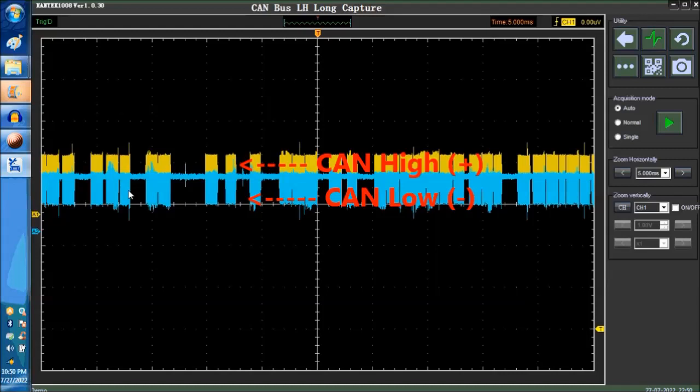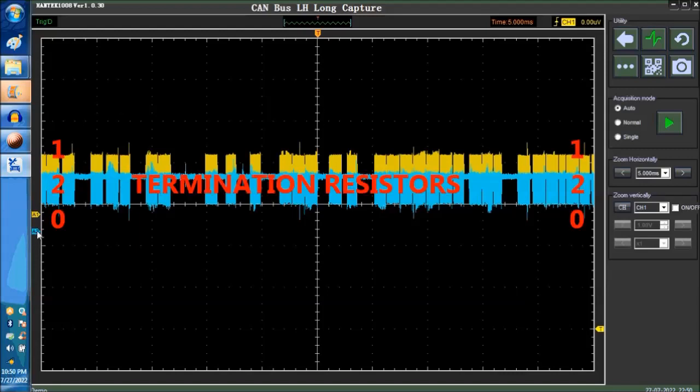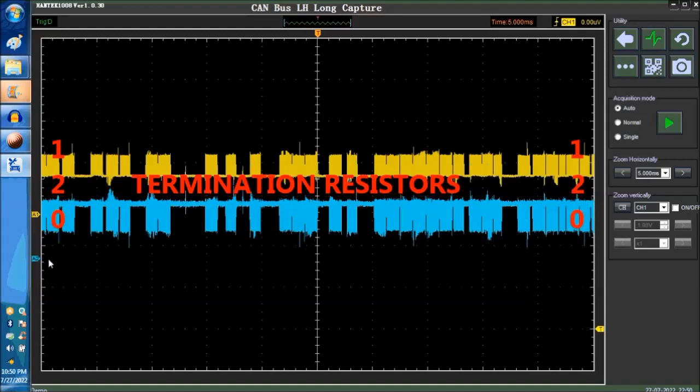And we have a bunch of videos like this on our website that explain the workings of the CAN bus. Basically, there are two parallel termination resistors connected onto the line, across pins number 6 and 14 of the DLC connector. That's the actual CAN bus. Between these two, you have 120 ohm resistors. Because they're in parallel, together they make up 60 ohms.